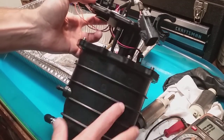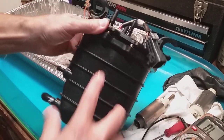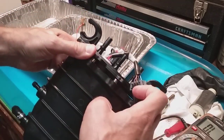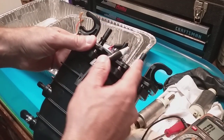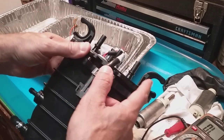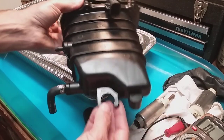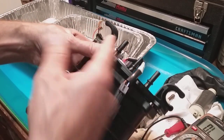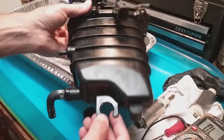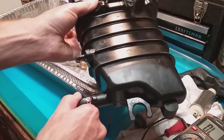It's at other places on other boats, but here are a couple of tips. It's obviously got the pumps in here — I'll show you those in a minute. It's got two bolts, and my bolts were incredibly stiff for some reason. The boat's in great shape; I don't know why they were so stiff — I felt like I was going to shear them off, so be careful. You technically only need to get this one bolt out. Luckily you don't have to get the bottom one out — that slips right off the bushing. This one actually slipped off the bushing, and then I backed it out carefully because mine was so frozen. Thank God you don't have to get the bottom one because the cowl is covering it very well and it's not easy to get to.